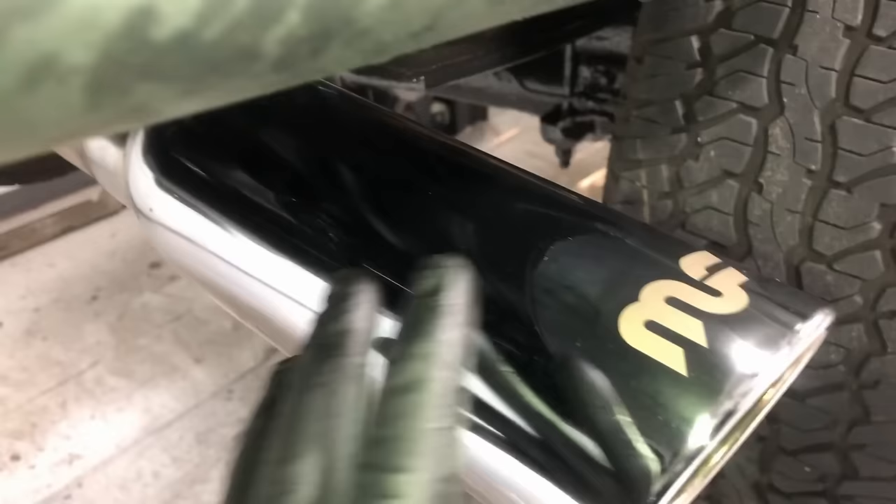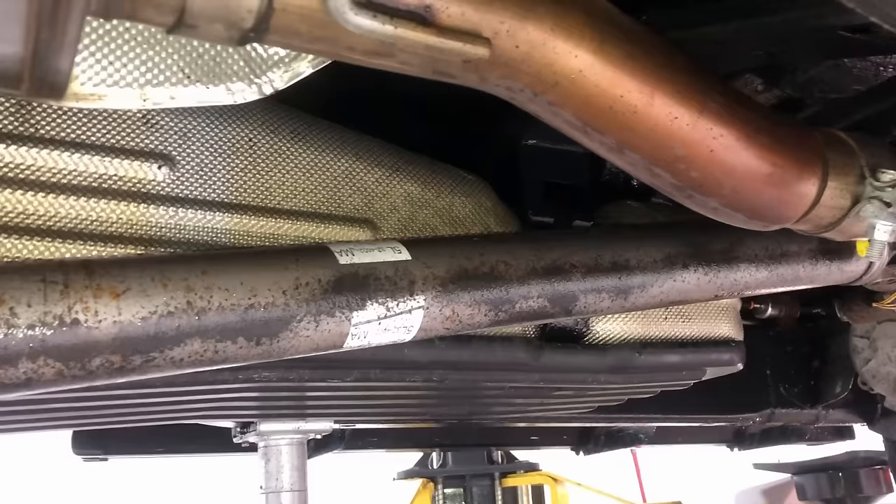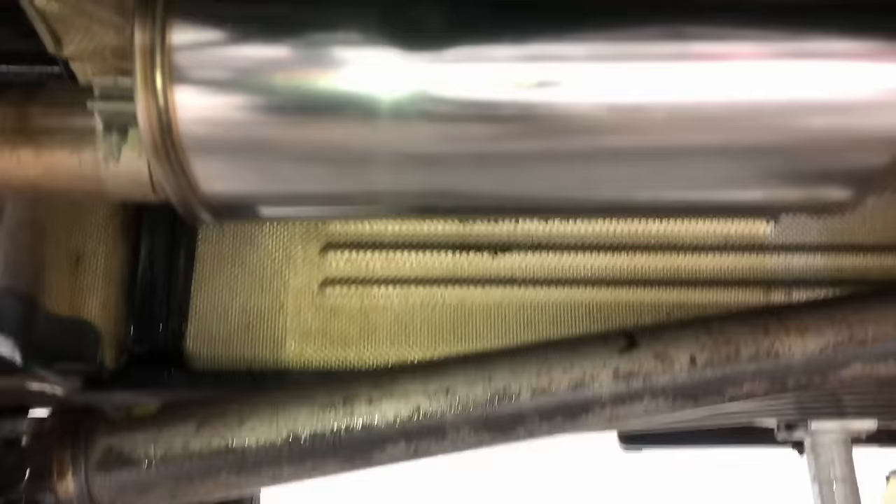Keep in mind when applying inside frame rails and rockers that are so common to rot from the inside: do a nice good coating and utilize all the different holes — don't just go from one end all the way through. Use the different holes to get different areas. Any overspray that gets on the exhaust or polished muffler — just take a rag and wipe it off and it actually polishes everything up. For the drive shaft, I did a little overspray and wiped it in with a rag to nourish the metal.